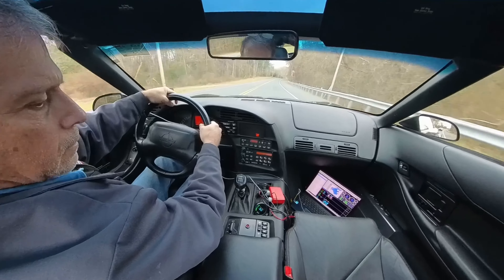I think I'm going to put this in a closed-loop tune because I'm cruising at 12 to 1. It needs to correct itself and cruise at 14 to 1. Well, I think I'm going to ride this into wide-open throttle — it ran a pull.